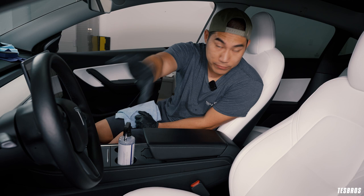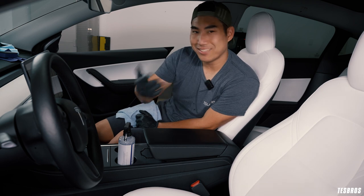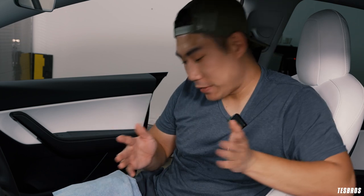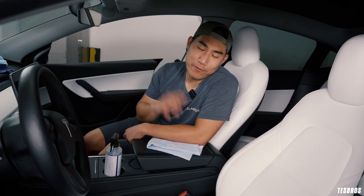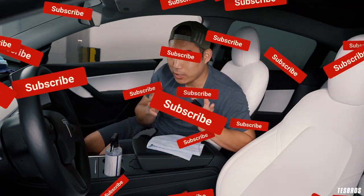This middle part of the steering wheel is also vegan leather, so if you want to coat that area, use very, very small product, let it sit 15 to 20 minutes, then wipe it down and you're good to go. I'm all done. All you have to do next is do the passenger seat and the back seat exactly the same way I showed you for the front seat. If you can avoid it, wait at least a night before sitting on it — that definitely helps complete the bond of the product to the seat and helps with longevity. Anything that's vegan leather on your car, you can coat it. Thanks for watching. If you have any questions, leave a comment below, and please subscribe.